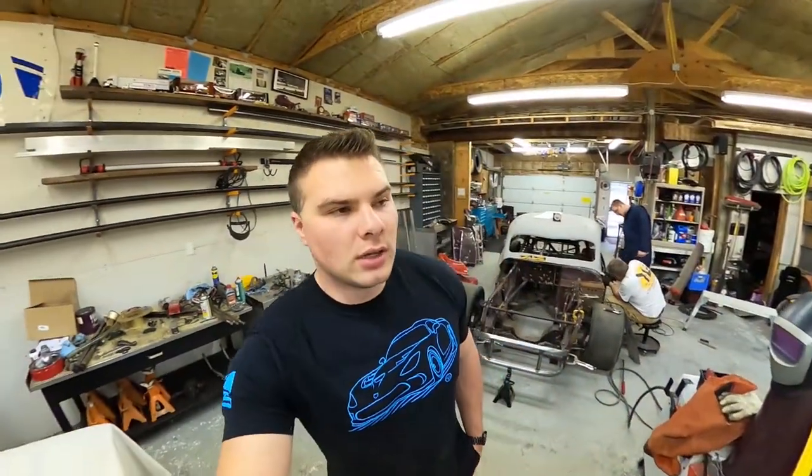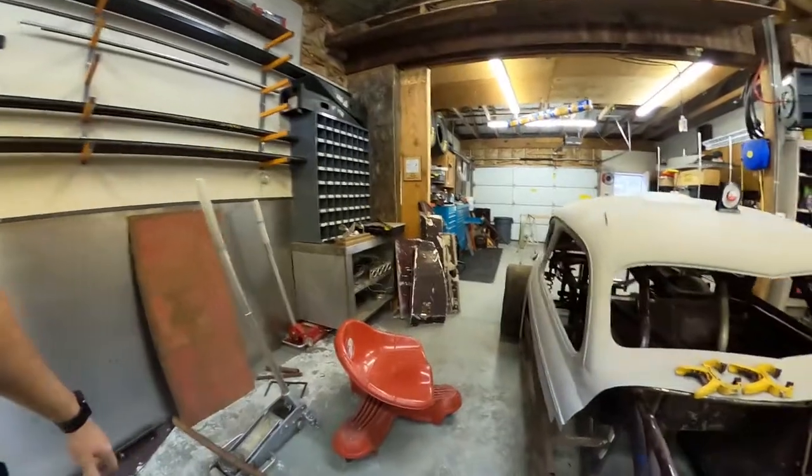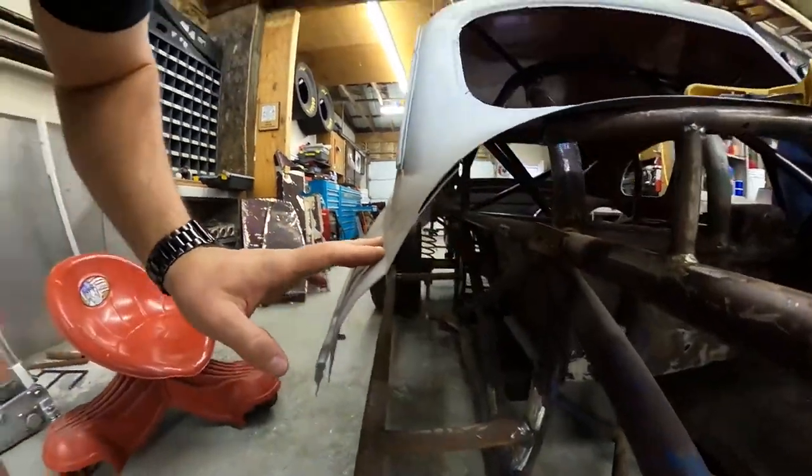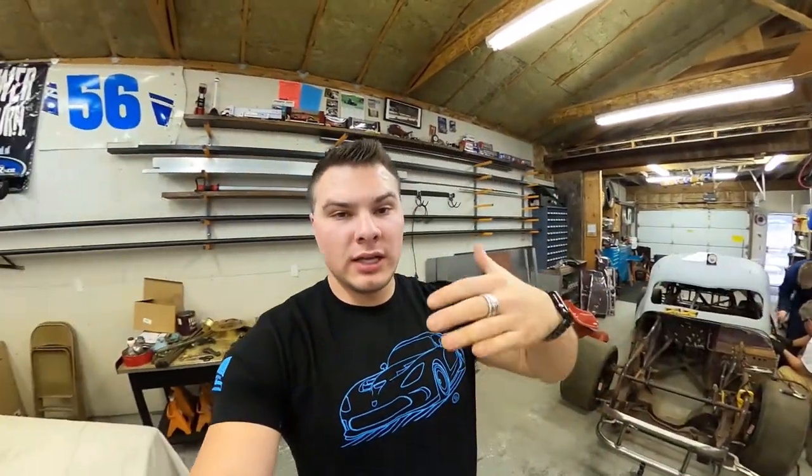Since we've had to contour this body to fit the frame, what we're doing is measuring out a piece of metal and shaping it. The piece that was on here was similar to this side over here, and this is all garbage — we're gonna have to redo this side as well. At some point somebody got behind there with another plate and did a terrible job. So we're going to cut out a piece of metal, weld it in, grind it smooth, and throw some bondo over the top. All these cars are covered in bondo anyway, and it's going to fit a lot better.